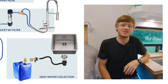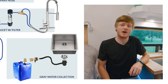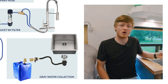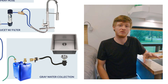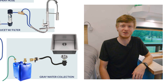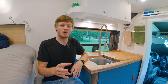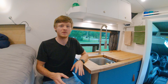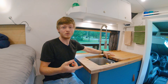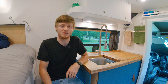The gray water tank also needs an air vent so water can drain into it easily. The Aquatainer has a little white cap on the back that can be opened as an air vent, but gray water can start to smell and you don't want it venting into the van. I added a vent tube to the gray water tank that passes down through the floor to the exterior of the van, using a section of garden hose and a quick-connect adapter to make the vent tube easy to disconnect. One thing I didn't show in the diagram is that I actually have a double sink, so I have two drains with a Camco drain trap on each, and both tubes connect together with a T before going into the gray water tank.